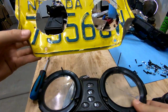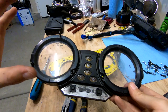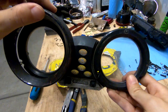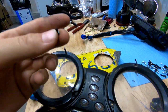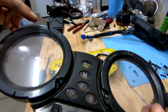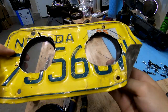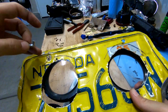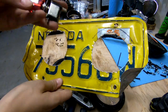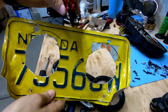So I finally got this all cut out so that the speedometer gauges can be seen from underneath. The goal right now is getting the speedometer mounted to the back of the license plate. This originally held the little hoods that went over the speedometer — it just had these awful little fairing screws, which was fine for that piece, but because I'm mounting it to something solid I drilled out the holes and put in a little 2mm Allen head. I've got some little wing nuts, and using 6 of those should be enough force to hold on the speedometer. We'll also have a little bit of space to squeeze in my 2 little switches, which is going to be awesome.